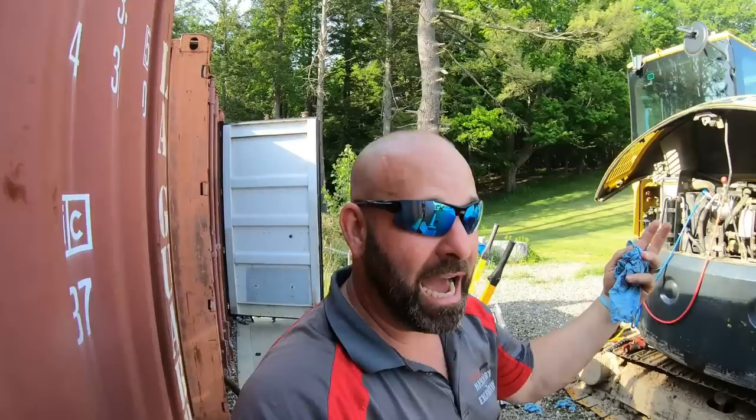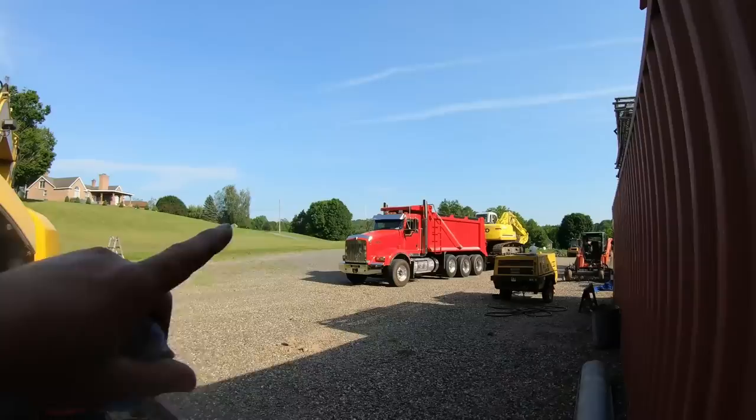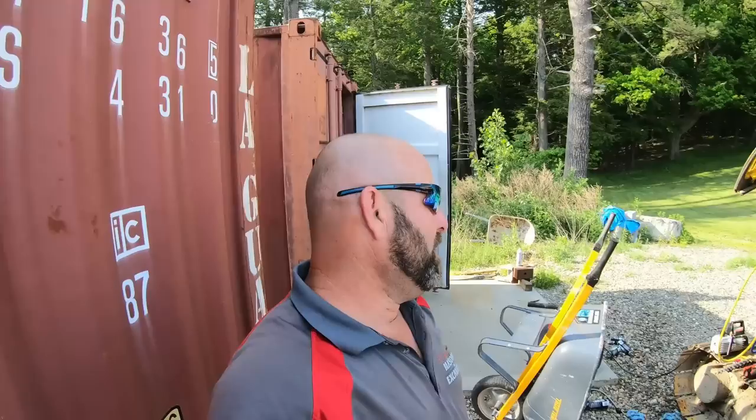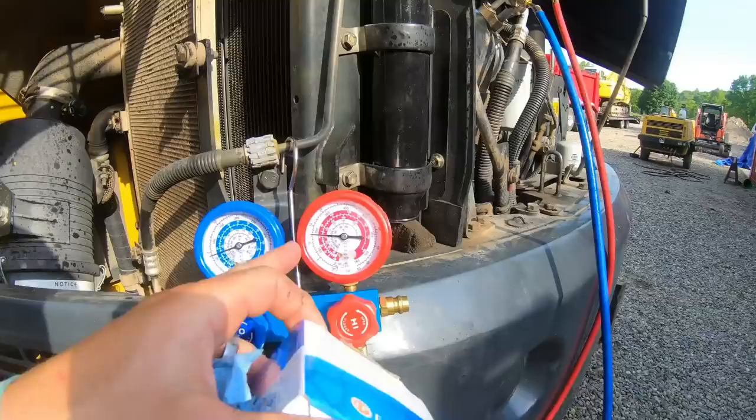AC systems are complex, but once you dig into them with your head they're really not. You don't need a ton of parts — if everything's tight with no air leaks, that's the biggest thing, avoiding contamination. I'm learning more about this than I ever wanted to, but everything I have right now is just about AC. When I shut it down these gauges are starting to equalize — it didn't equalize until the next day before, but now they'll line up within five minutes, which is good. Next fix is the 20-ton trailer — if anybody knows of a trailer for sale, hit me up in the comments. Again, guys, FridayParts.com — check them out. Thanks Amy. See you guys on the next one.